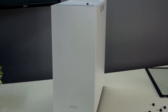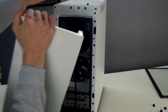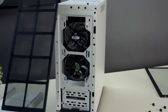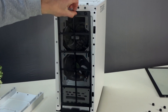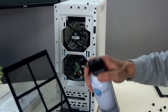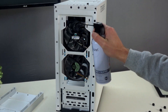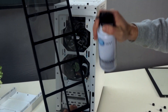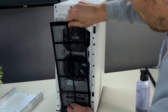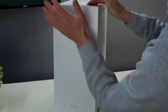Now for the filter in the front — it's got a nice clean all-white front that pops off with a couple of clips, and there's another dust filter behind that. Use a little bit of force; NZXT builds very nice cases so you can pull on it. This front cover is magnetic and sticks right to it. Once it's off, you have better access to your intake fans, and you can hit both the fans and the filter with short bursts. Then place the filter back, line the cover back up, and you're done.